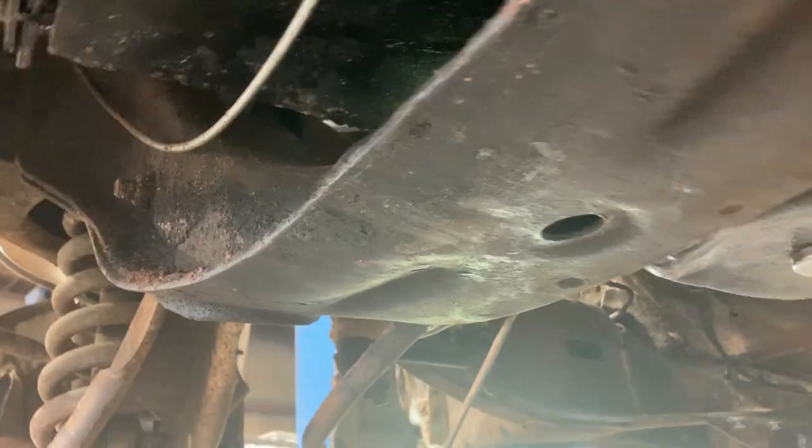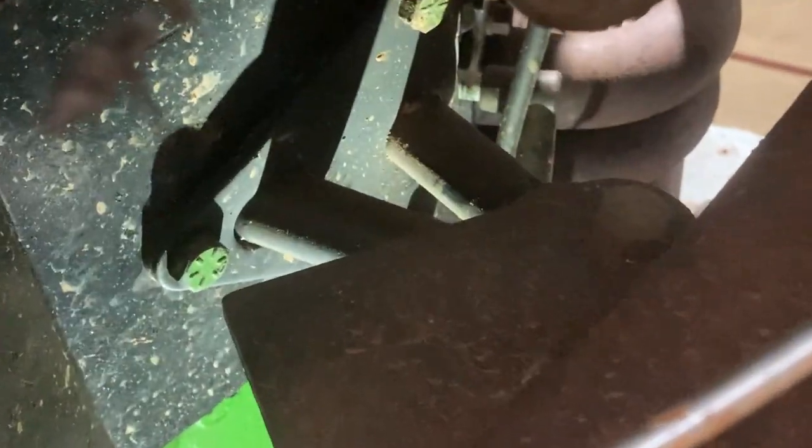The coolest one, I would say coolest, but one of the most unusual is the motor mounts in the car. So if you do get hit up in there, it's not going to tear the block apart. It's just either going to shear the bolts or bust that other mount off. I've wondered about that on these cars, how you protect that. Yep. And you do it with special mounts. I'd never thought about that. I figured there was always a chance of breaking the water jacket or something in the block as hard as these hits are. Yep. And now I know.